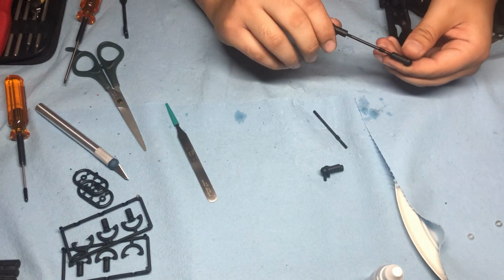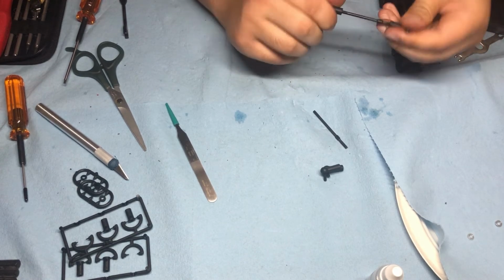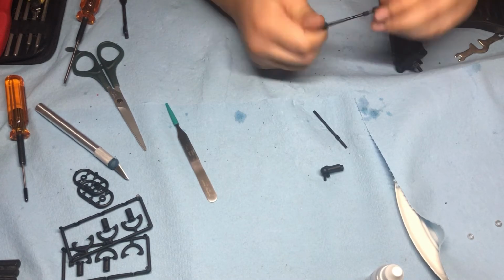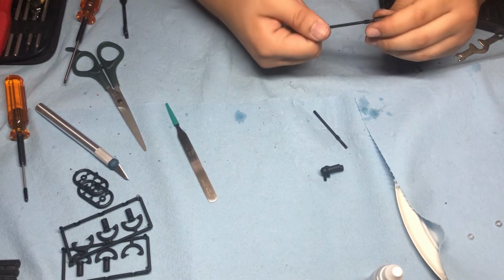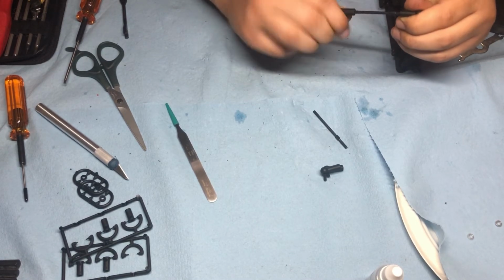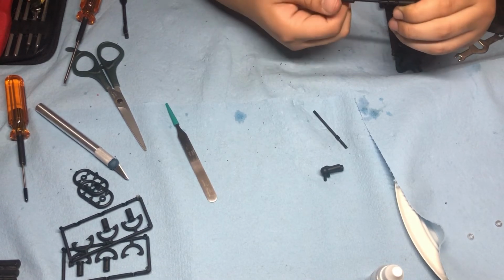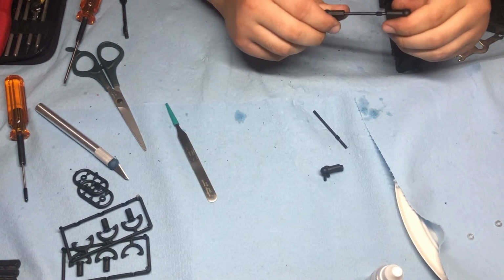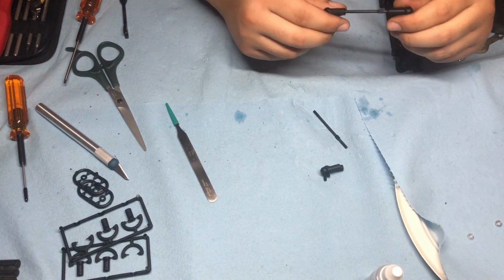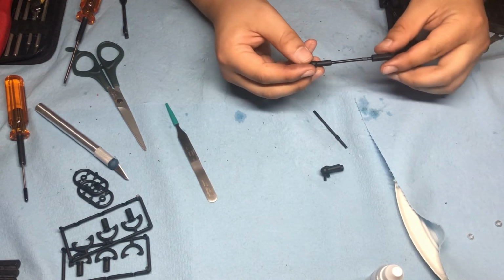So that's how I'm setting it up, and it'll make it easy to understand and fix your car if you do that throughout. Also, that way when you decide to make an adjustment, whether you're lengthening or shortening a turnbuckle, it's the same movement left or right side of the car. Alright, for the steering links, we want 40 millimeters length, and the rod ends are going to be 90 degrees from each other.